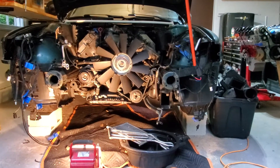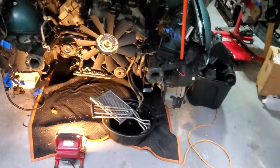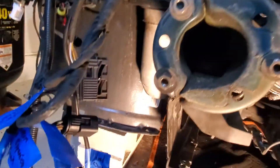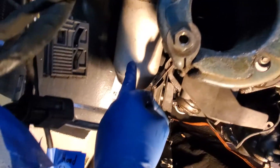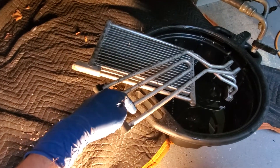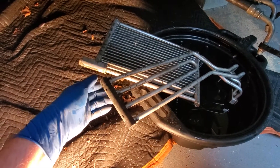It's Friday night, just working on this BMW. I got the AC condenser out — that attaches right there to the high pressure and low pressure lines. The high and low pressure changes at the orifice tube. That's your filter dryer with desiccant in there. Down here I've got the trans cooler and the engine oil cooler. These are from 1995, the year my car was made.